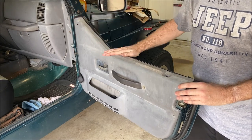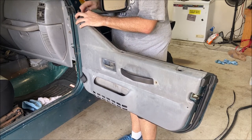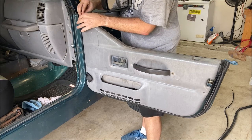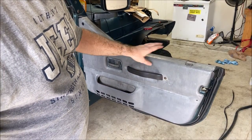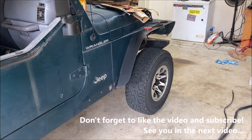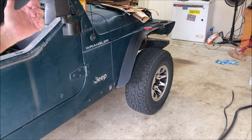Got it wrapped all the way around, and now I'll go ahead and put these three posts back in place. For this one, you want to make sure that the seal is underneath the plastic door panel, lined up with the hole and flush up against the door frame before you put this in. Remember, when you put it in, you put it in 90 degrees out from where you want it, press it down, and then give it that 90 degree turn, and that'll lock it in place. Make sure the seal is where you want it to be. If you took the door panel off, put the door panel back on before you put these three posts in place. Put your door panel on, put the posts in, put the screws back in that you may or may not have removed. The door's put back together — then just shut it, leave it shut for a while, and that'll let the double stick tape really set in place to hold the front of the seal. By far the hardest part is getting that adhesive off so that you can get a good surface for that new seal.